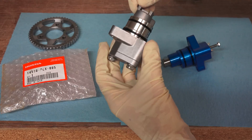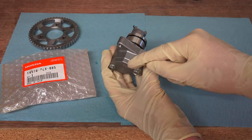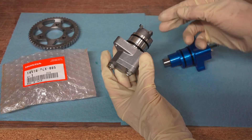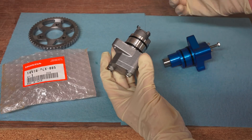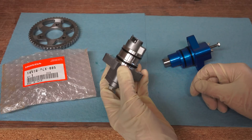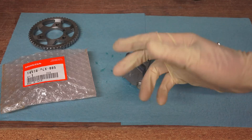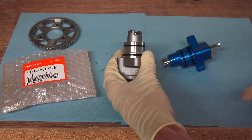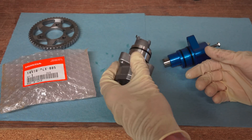This has a pin in it, so once you install it you remove the pin and that cylinder pops out. Over time there's a worm gear inside that starts to wear down and it doesn't hold quite as much pressure on that timing chain. As the chain stretches you need more tension, and as a result you'll start to hear it rattle. That rattling is the sign that this thing is starting to go bad. On mine, the timing chain only rattles when the engine is really hot — if I've been driving a while and it's hot outside and I'm idling, you'll hear it rattling around.